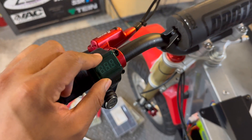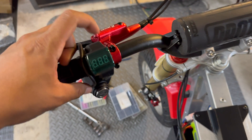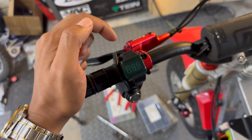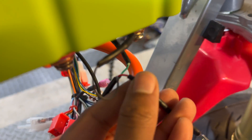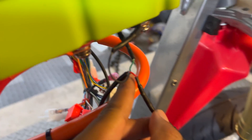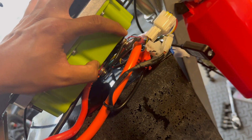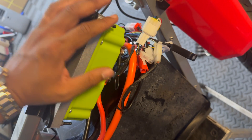I didn't like that I was able to immediately see the voltage as soon as I plugged in the battery, and the controller doesn't seem to be turning on. I'm going to check if the wiring in this specific ignition switch from Amazon is switched — sometimes they are. So I'm going to swap the red and green wire and see if it makes a difference. For diagnostic purposes I swapped out the terminals for the green and red wire on the ignition. It shows 79 volts on the controller when I check with a voltmeter, and when I key on, the signal wire going to the orange wire on the Far Driver is getting proper voltage — so I'm not really sure what's going on.